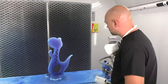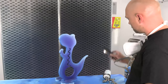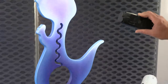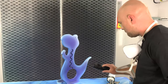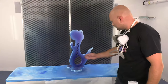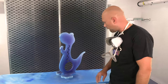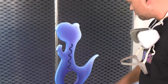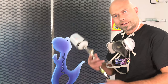Alright everyone, we are back and we are totally done spraying color. It looks really cool — a lot of bling, a very cool effect. What I'm going to do is let this dry up for about a half an hour to 45 minutes, then spray a little bit of 4050 here on the tail — because this is where we're going to letter, right on both sides. I just want a nice level, even surface to cut my vinyl mask on. So we're just going to do a couple coats of 4050, walk away, let that dry overnight, and come back and cut some letters.